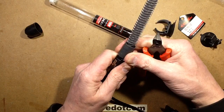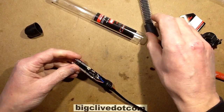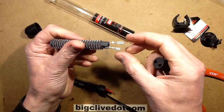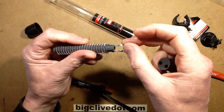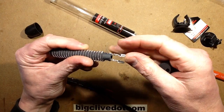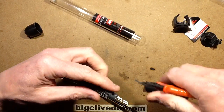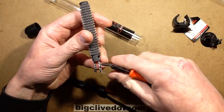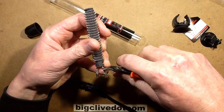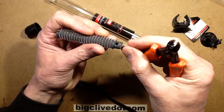It looks as though it's just a couple of little mini spade terminals that are going onto the heating element. Yeah, so that's just got two little lugs. The heating element itself has a sort of usual arrangement with twisted wires to mate onto the heating element wire itself — that's something I may have actually pulled off. I may have to crimp that back on again — let me crimp it right now by using the snips in an inappropriate manner. Let's just mush that down. I don't think it would solder on — it's going to get quite hot so that's not necessarily going to be ideal.